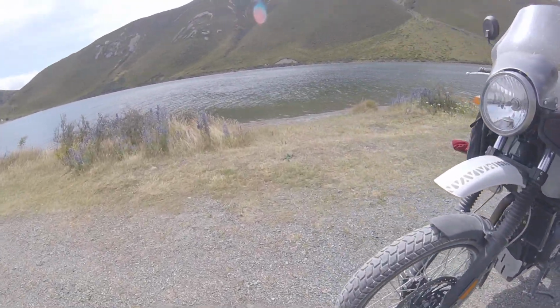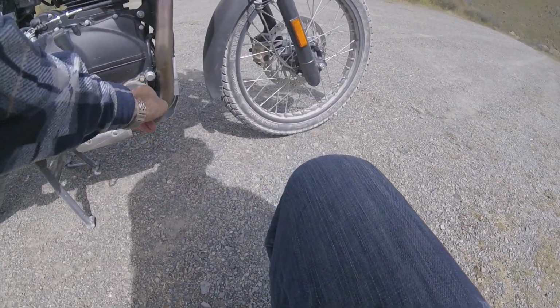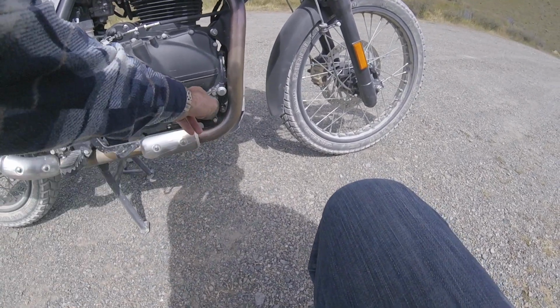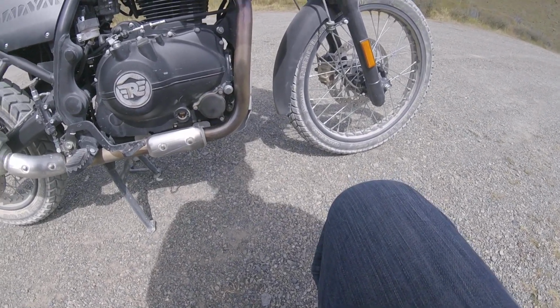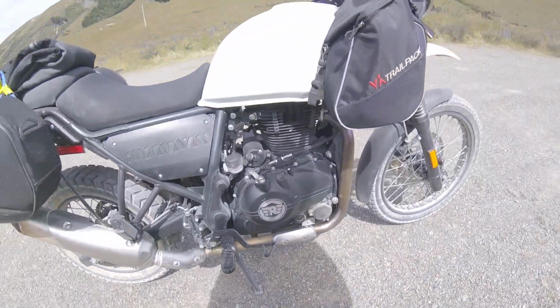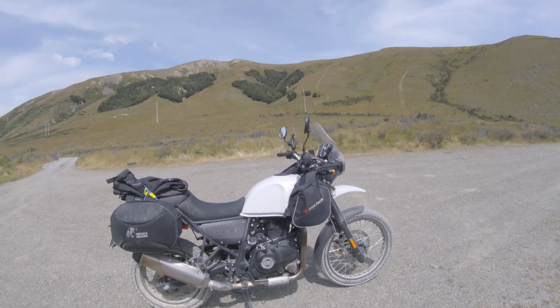So I think that's about a 21 or a 22mm socket, and then these 3 are a 5/16. One bolt's longer than the other. I think it's this one here. It might be that one actually, the bottom one. And then there's a gasket and there's a rubber O-ring, so normally you would replace both. And there's a copper gasket on the sump bung, and then you've got your little oil filter. It's only a short filter, and then it should be filled up to the mark like it is on here at the moment. It's just up on the mark, and yeah, it's very easy to ride.